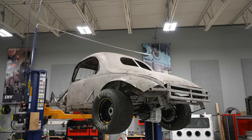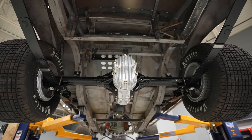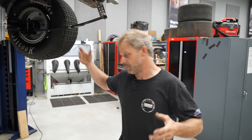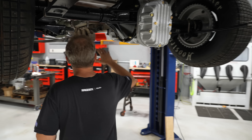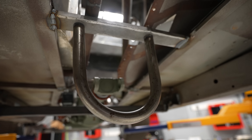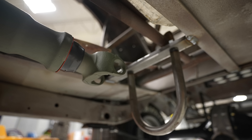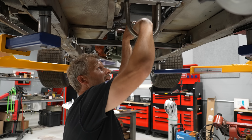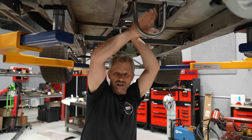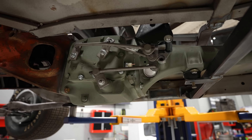In here, we have all the rear suspension hung, mocked up — mounts, all that stuff is done and ready to be disassembled, painted, and put back together. We've gone through and put in a driveshaft loop, which would be required in a racing situation. That way, if your U-joint breaks on your driveshaft, it keeps the driveshaft in here. It makes a lot of racket when this end breaks and it walks around and wobbles, but it saves your arms from getting hit by the driveshaft.